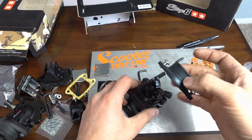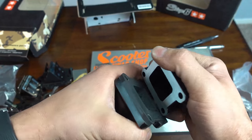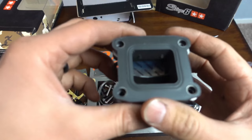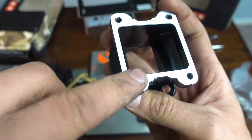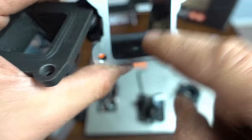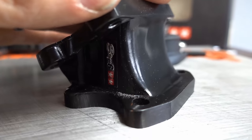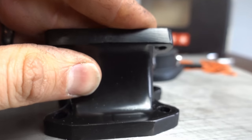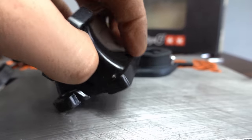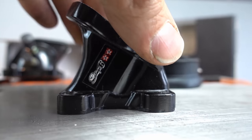We've got the bolts removed from the manifold and the rubber boot taken off the front — pretty easy to take apart. Basically, take the boot off first and then you can access the four bolts. Pop it apart. Guess what — no gaskets, because you've got this rubber coating here. Another nice machined surface. You can actually see the lines where the rubber was contacting. You've got your rubber reed cage here — nice fit. Another machined surface here and another here. No scratches, gouges, or chips. This one definitely has a nicer, smoother casting and it looks to be really true.